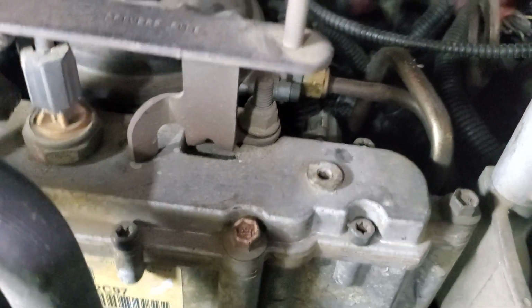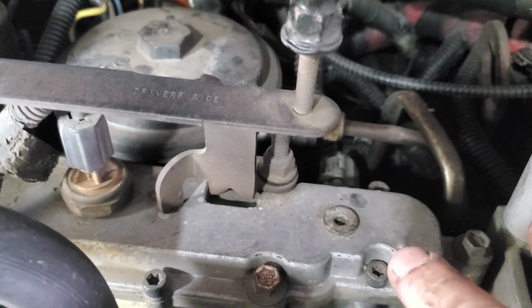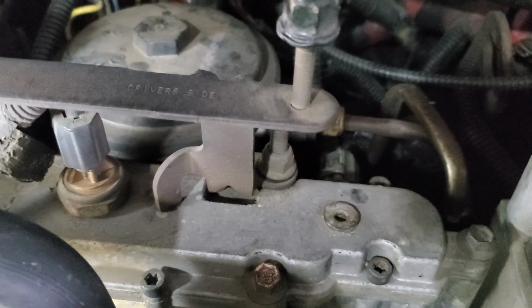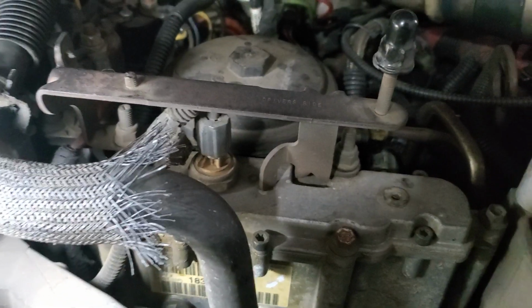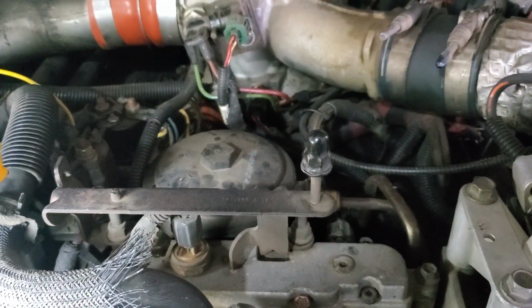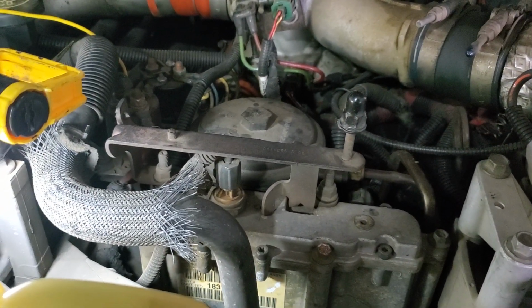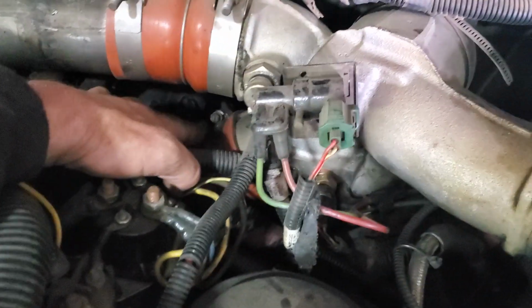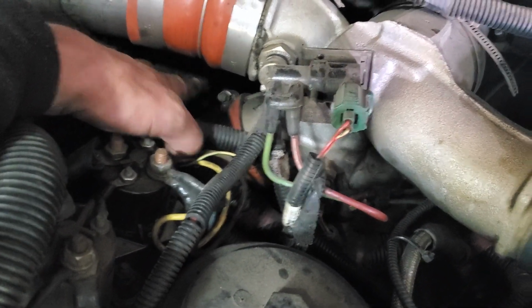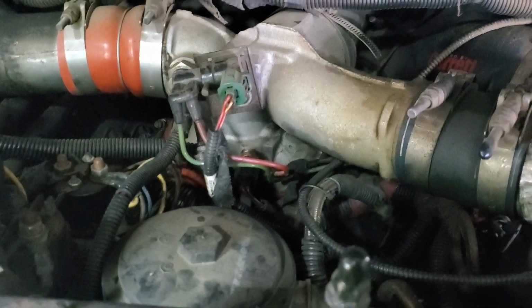And then my last fill, that's where I'm going to directly put that arch oil in, and then it's going to go straight into the injectors, and it's going to clean those spool valves out. Every time that I've put that stuff in on these, I'll hear those injectors start to liven up, right? So another small thing that we'll look at too is we're just gonna check these boots here that go off the intake straight into the head. I'm gonna make sure that those are tight.